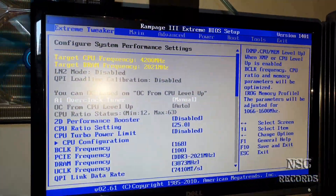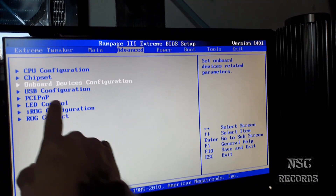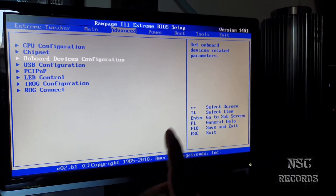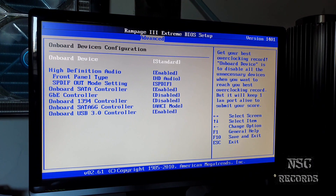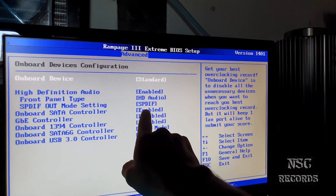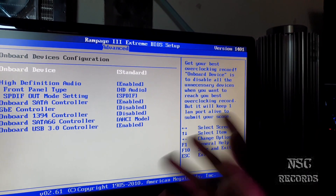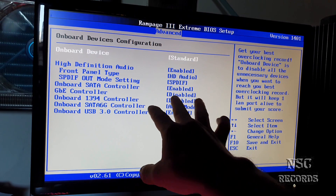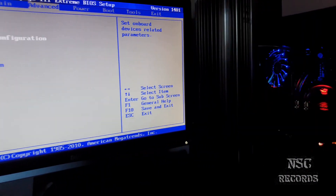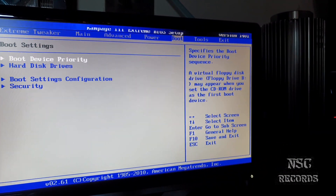Now I'm in the BIOS. I'll disable the lights. Somewhere in the BIOS you're going to find an option under onboard devices — not on all motherboards. Here you can see 'onboard SATA controller' — this should be enabled. Sometimes it will work even if disabled, but being disabled can cause problems. This can be the reason why your SATA card was not recognized or not detected. Enabling it will make things work way better.